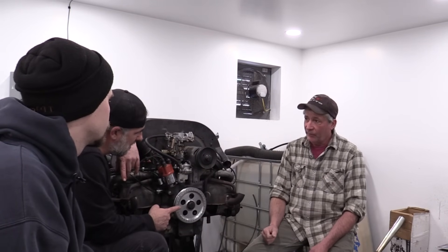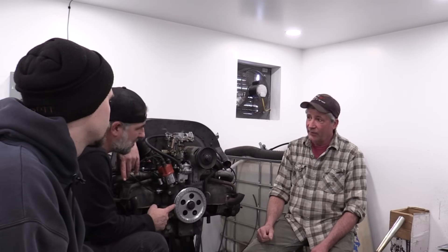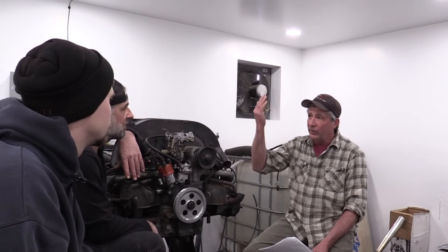In a stock application like this, you're just not going to see massive gains by changing your exhaust system. We actually found that a stock muffler was pretty darn good. We put a racing exhaust on and that was probably the best one — it did pick up — but still, it wasn't over-the-top numbers where you'd really notice it in the seat of your pants driving.